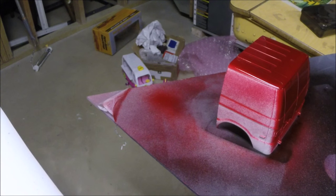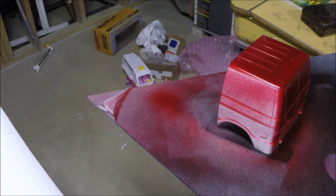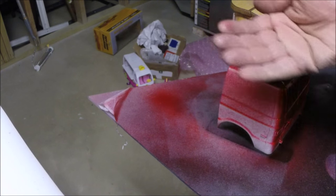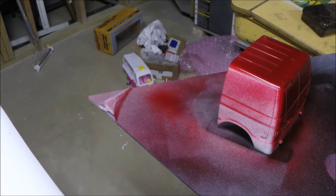The lunchbox, the pink one, is just top coat. There's no clear. Most of the time I don't use clear, but you can use clear. After this is done, you can put clear coat on there, two or three coats of clear, and really get it to shine up. On my deadbolt roll cage, I did base coat, like three coats, and I did six coats of clear on it to give it like a protective barrier in case I chipped it or hit it. It wouldn't take the top coat off, like the red wouldn't come off. Just the clear would chip and the red would stay intact.